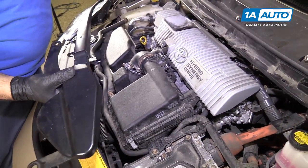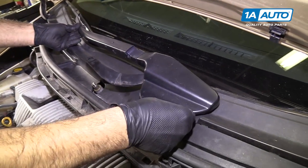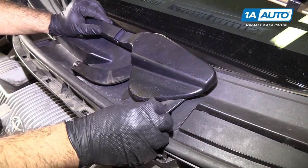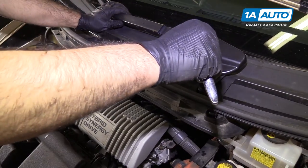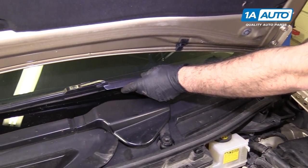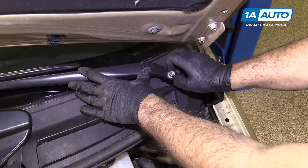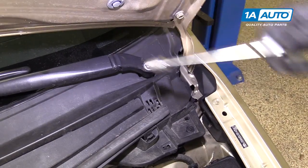Put the passenger side wiper arm in place. There was a dust line where the wiper blade was, so use that as a reference point — right about there. There's some spring tension pushing it back up. Install the nuts and tighten them down until snug — don't overtighten, as you don't want to break off the studs on the wiper transmission. Reinstall the driver side wiper arm and blade — you can do this with the hood up or down. Get it in place, reinstall the nut, and tighten it up. Stop when it feels tight to avoid breaking the stud off. Then reinstall the cap by pushing it into place.